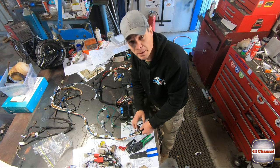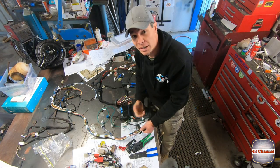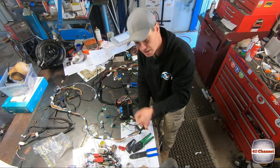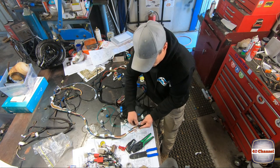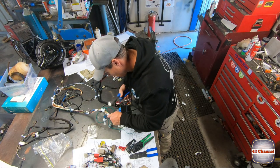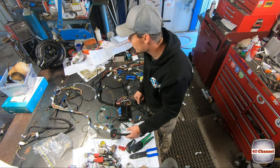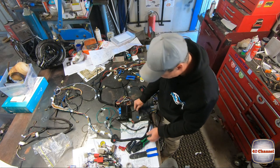The trick is as you're wrapping this, you want to pull it tight and pull it right around, keeping that tape tight the entire time as you wrap, so it pulls all those wires nice and close, nice and tight together. That gives a really good foundation and strength to the wiring loom. Just continue on down the entire wiring loom - you get the picture, it's pretty nice.